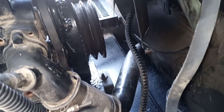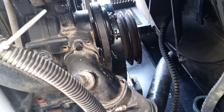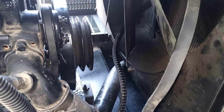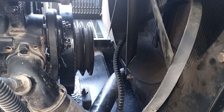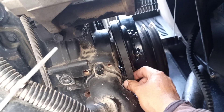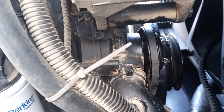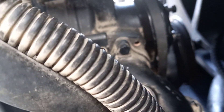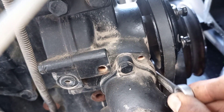Hello guys, good day, good night. This one is the 1500 series, okay. There is some problem with this one. If you are a new mechanic, first time to change the water pump belt of this engine — a 1500 series Perkins — there is a technique you need to know, because there is one bolt, 13mm, inside here.